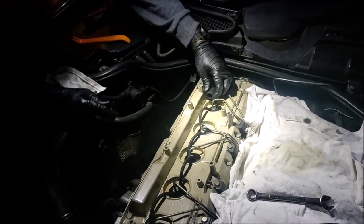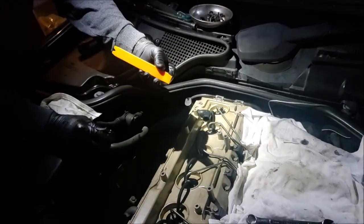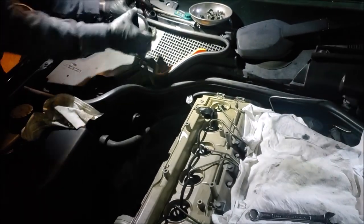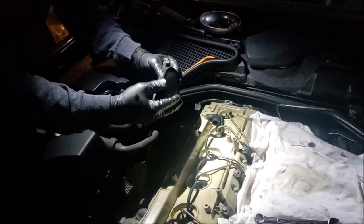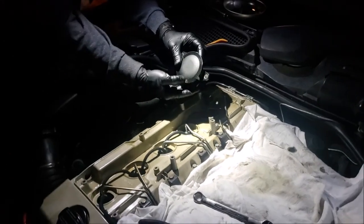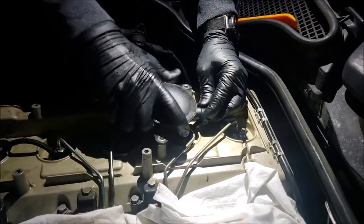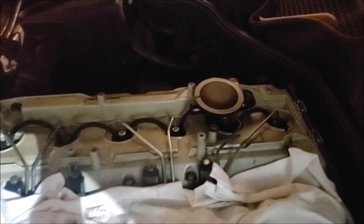The new one's very pliable, as you can see, and it fit nice and snug in the hole. I pushed it in with this little plastic crowbar, I guess you might say, in order to not damage it getting it in there. You pop that in, wipe off this baffle a little bit, slide the baffle back in place — there's a directional arrow over here telling you which way it breathes. Pop that into there, fits nice and snug, so there will not be any oil dribbling out of there.